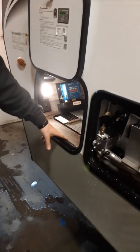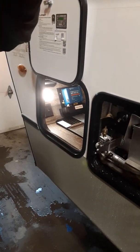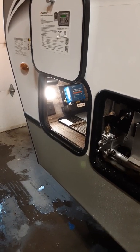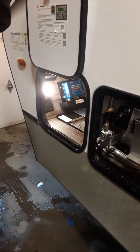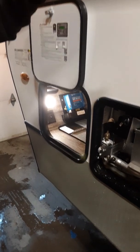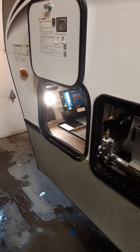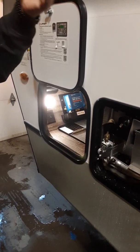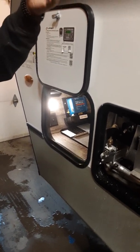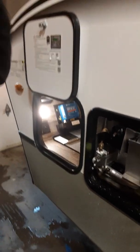But I believe this one has one that's just quick connect. So all you have to do is turn another lever, and it'll pump through that hose. Which then you go inside. You gotta turn on all your faucets. You gotta make sure that pink from this is going through the lines and going into the drains. I'll know that when I turn on one of the faucets inside, pink should come out. Yep, you'll see a clear pink coming out of those lines.